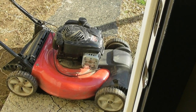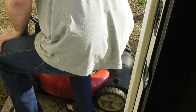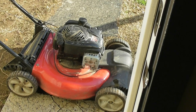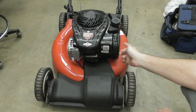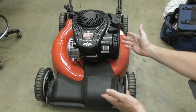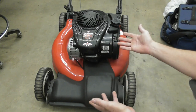All right guys — it's a new day. I've got a clamp on the bail arm. I'm going to start it back up, let it run for four or five minutes, and see how it does on a warm start. I lost a lot of clips — it's been a couple of months since I've even looked at this thing. Bringing it back up to speed: I washed it, I inspected the belt, I changed the oil, I received and installed the air filter, saturated it with oil, and put the cover on it. All in all I'm in for $17 in oil and components. One of the clips I lost was going to be a warm start — I had to prime it to get it to start after it was warm, but I didn't have the filter yet, so we're going to do that test again. A couple of zip ties as well. There's no filter gasket that goes right here — it doesn't leak, it's just the way it's made, that was a new one on me. Everything's looking good as far as I'm concerned.